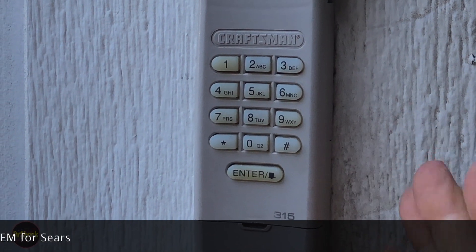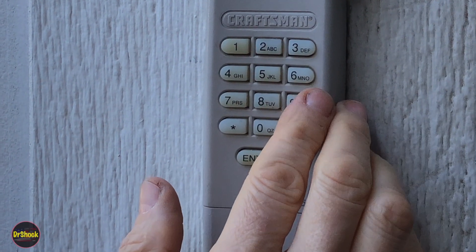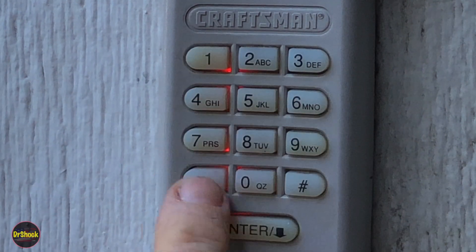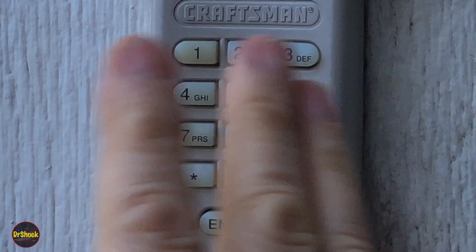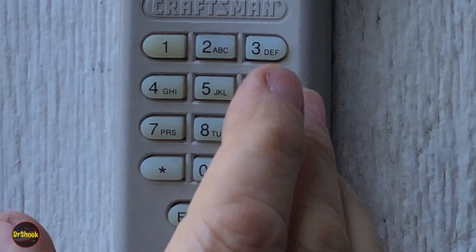Right now it's in the upper 40s and it has failed to function. If we zoom in, with this particular problem you'll find that only half of the backlighting is coming on. We can see it's lighting up red here and here, but not in the third spot — when it's warmer the whole thing lights up.